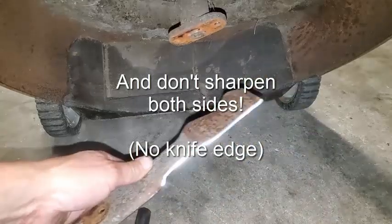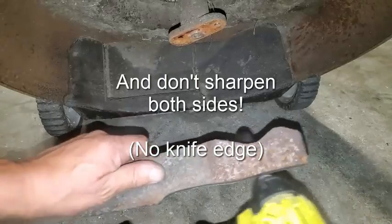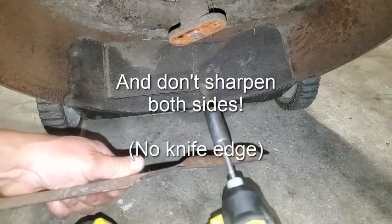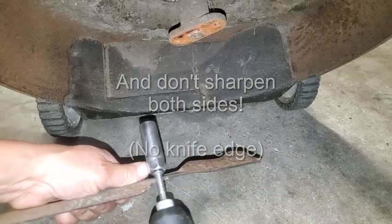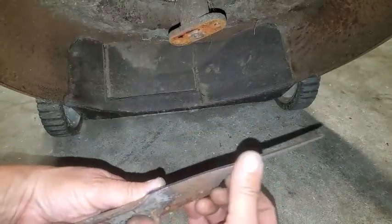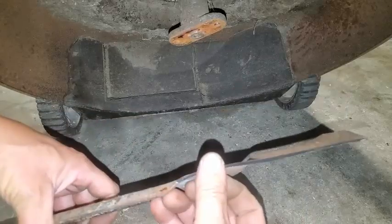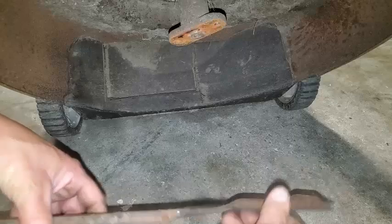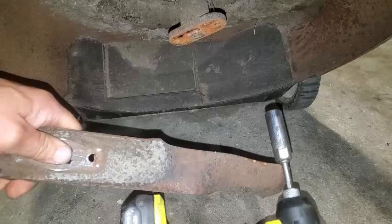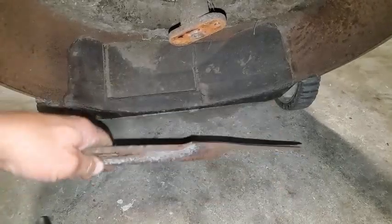Pretty good. I could probably take a piece of steel and just knock off the last little burrs. You can use a punch, something like that, just a piece of steel to blunt the jagged edges if there are any left. This one's pretty good. This one's really good. So it's kind of deburring it. Deburr and burnish. Okay, so that's that.